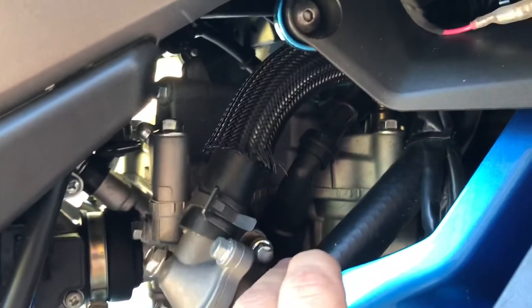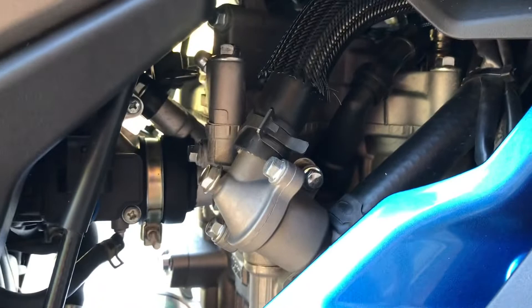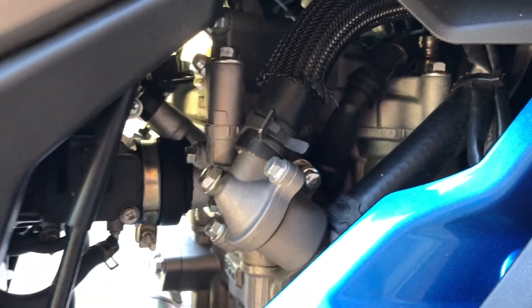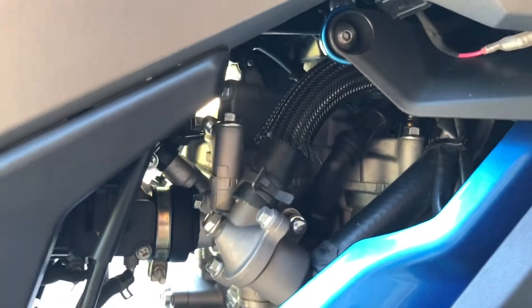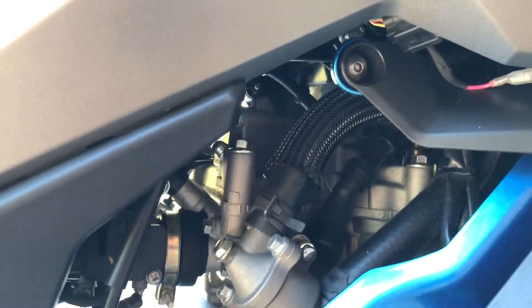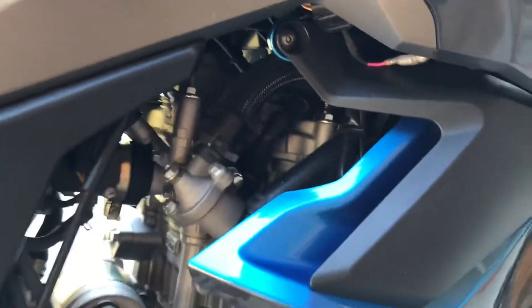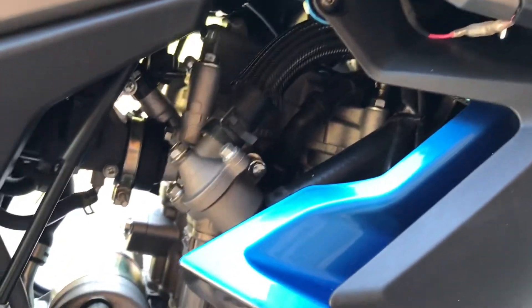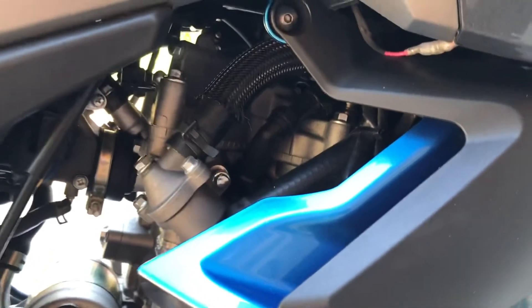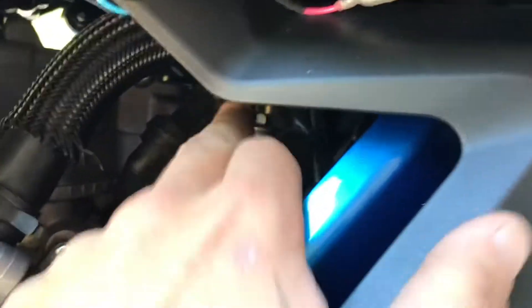When I pulled it apart, it was all broken up in there and destroyed. I'm not sure how — maybe from having to take it off so many times because of the HT lead getting wet when pressure washed. It's all right in the rain, but with high pressure water I'm guessing it gets right in under the cap. So I had to replace the HT lead. That made me think that was what the problem was with it cutting out when I put it into gear — obviously it wasn't, I'll get on to what it was in a second. I had to bodge one together on the side of the road with some tape for a couple of days. You've got a bit of copper wire — I literally just plugged it straight in and then taped it on. It lasted me a week until the new one came.